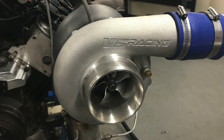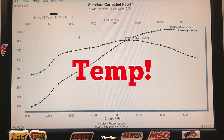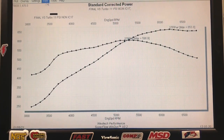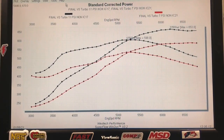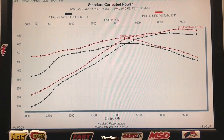Now let's take a look at the same combination run at higher boost — ten and a half pounds. Even though the gauge up here says eleven, I'll explain that in a second: we actually had a little bit more boost on the non-intercooled run than on the intercooled run, even though we didn't change the boost controller setting. Run at eleven pounds or so, this thing made 653 horsepower non-intercooled and 599 foot-pounds of torque. Here's what it looked like compared to the seven-pound non-intercooled run — big gains everywhere, as we'd expect when we go up in boost.